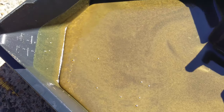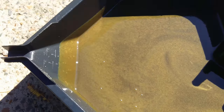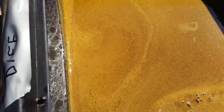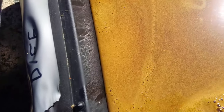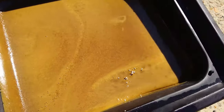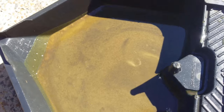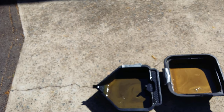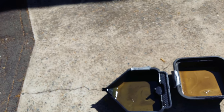There's the gearbox oil — still fairly thick, it's done its job. And this is the diff oil. The viscosity is good. With the gearbox it was just the breaking-in process while still at 140 viscosity, and trying to get that first gear change between first and second.